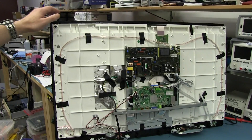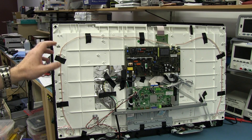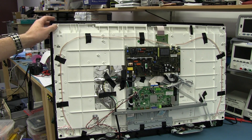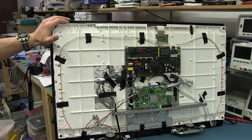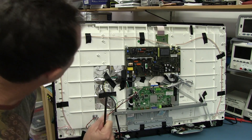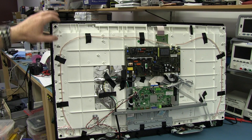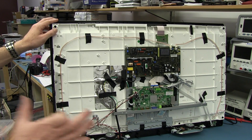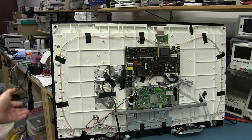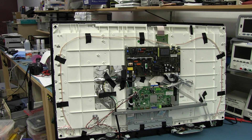When I was playing around with the thing, I touched the TV and the image actually vanished or flickered or did something. That indicates there's some sort of physical component to this fault — it was too much of a coincidence. I gently touched the front of it and the image vanished. That indicates a physical component, and it's most likely the main fault — some sort of connection or something like that.